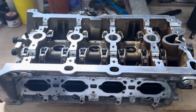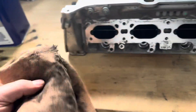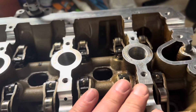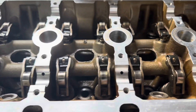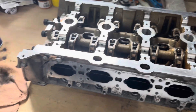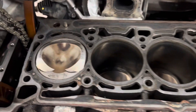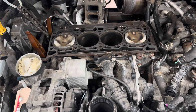Before putting the head back on, I went and cleaned it up. I got about a gallon of acetone and just a rag — this was clean when I started — and just kept buffing it, elbow grease throughout. Occasionally for the heavy-duty stuff I'd use a razor with a little bit of acetone, and she came out pretty nice. Some people say use a Scotch-Brite or sandpaper, but I don't trust that. I did the same thing on the top of the cylinder block, so the mating surface will be nice. Now I'm ready to start putting this whole thing back together.